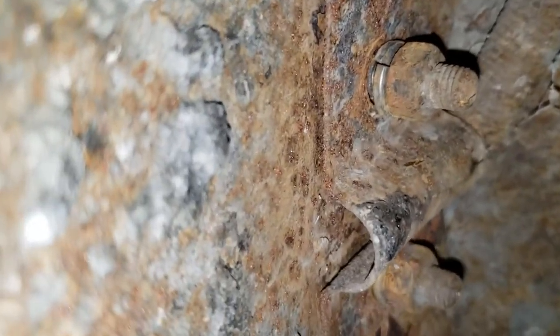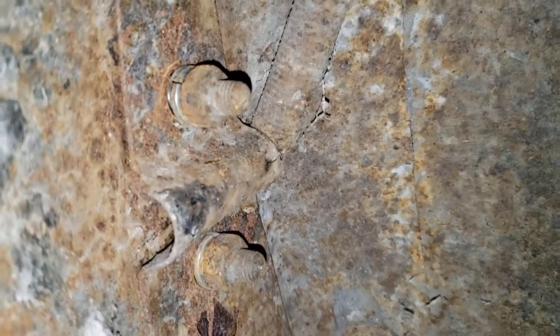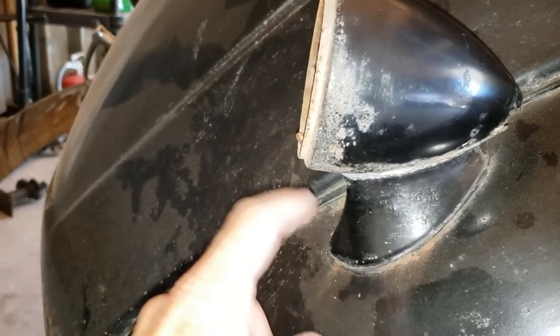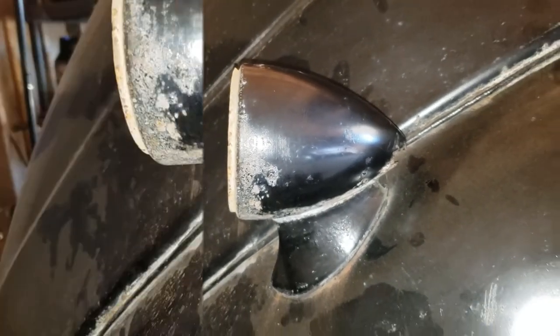What I've discovered: the two mounting bolts up here — I was able to loosen these up from underneath the fender. There's a newer screw and washer on there, so someone had these off in the past and may have had the same issue with a poor connection. As I wiggle this with the bulb in and the lights on, it's intermittently coming on — so I know it's just a bad connection between the fender ground and the headlight shroud.